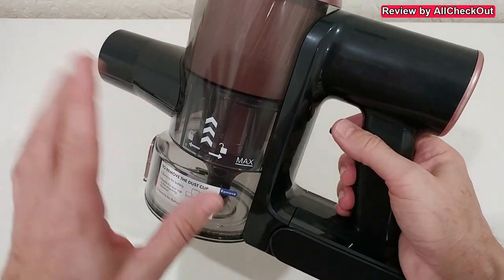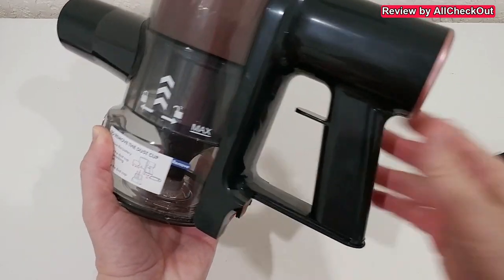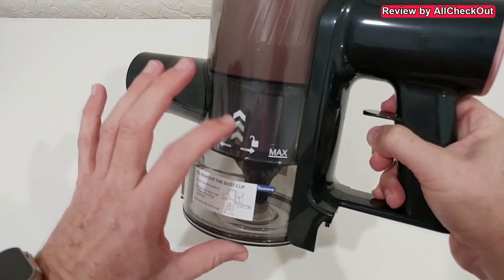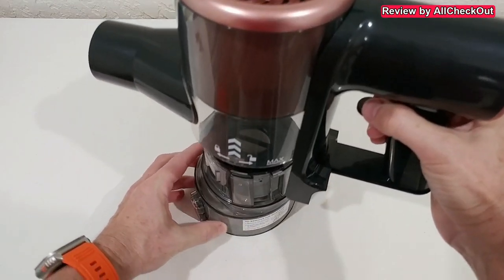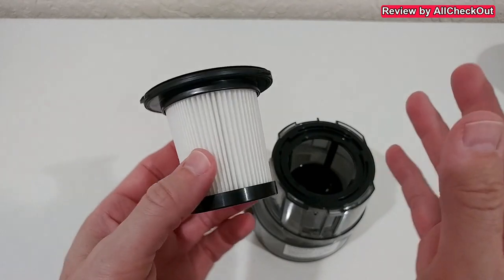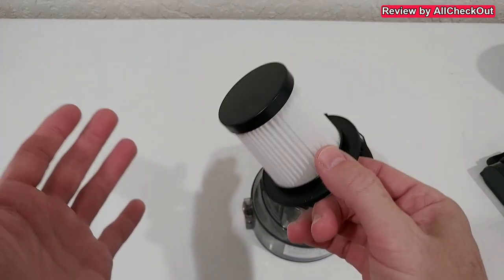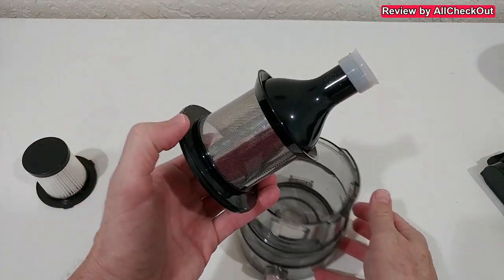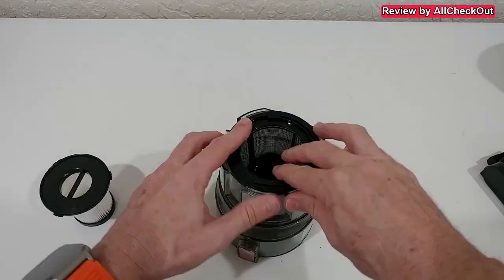We have even more — there's an unlock possibility where we can remove pretty much everything. We have to remove the battery first, then rotate this part clockwise — make sure you're just twisting this one part — and then pull it down with all the nice filters. You can clean the filter either with a dry brush or under running tap water, just make sure you dry it for 24 hours before using it again. We also have this part of the filter with a nice metal mesh — multiple layers of filtration.